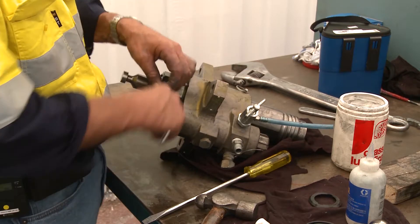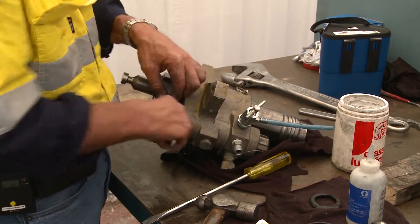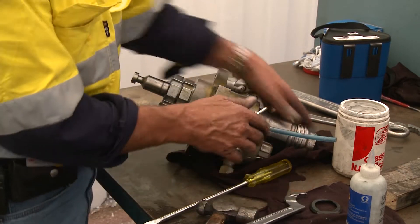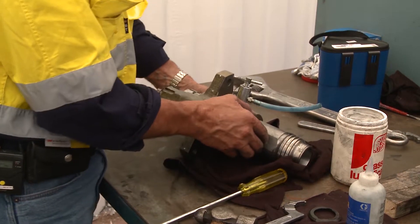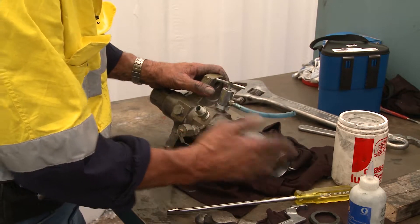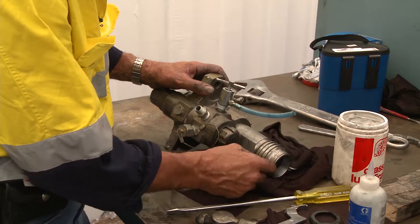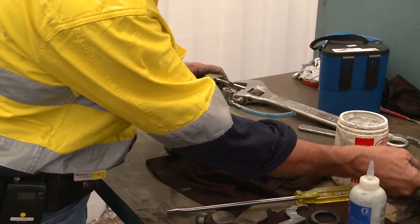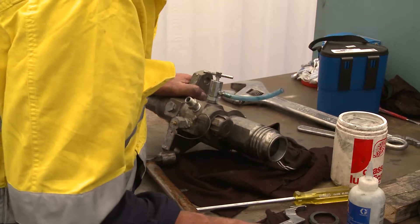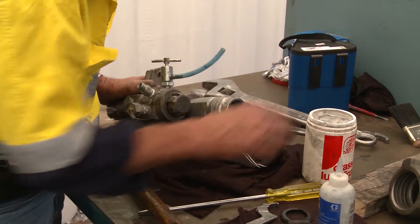There is absolutely no need to fill this pump with paint or solvent to prime it. After a new installation or repair, when you start the air motor, it won't suck up immediately — you'll do five or six revolutions of the air motor to start the pump sucking material in. You can pre-prime the hose that feeds this, or fill it with solvent to assist.